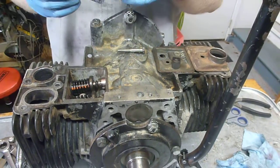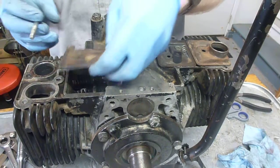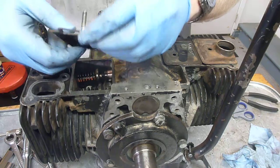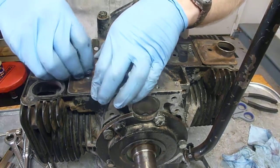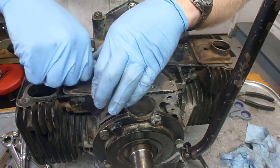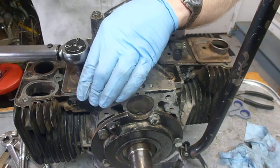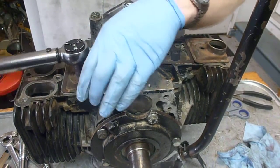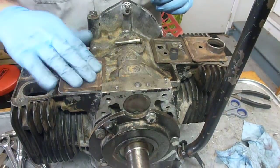In that case, you only need just two covers like this. But in our case, we have to put the breather in, so that's just an additional step. We already have the gaskets lined up - it's a pretty simple process. Put the covers on, get the bolt in, line everything up. Then we have to torque these to that massive spec of 2.1 newton meters. My torque wrench doesn't even go that low, so we're just going to tighten them down and be done with it. They don't get very tight.